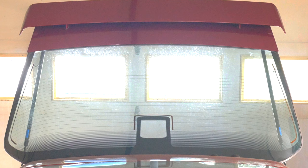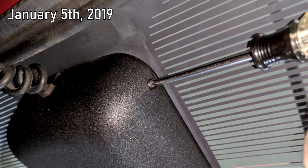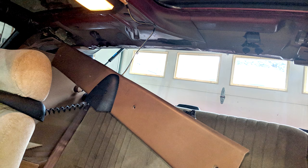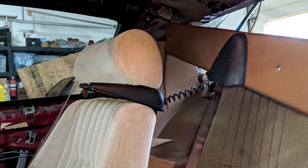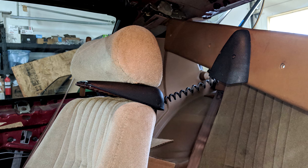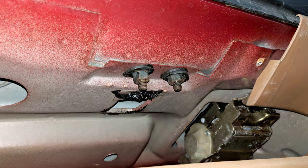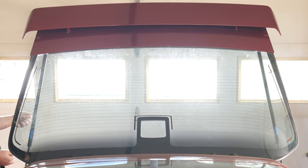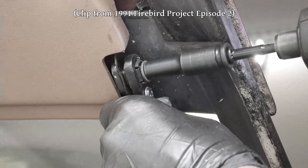To get started, the first thing we need to remove is the high-mount brake light. The housing is held to a mounting pad on the hatch with just two small screws. With the hardware out of the way, we can slide the housing off the mounting pad that's glued to the glass. Then we can remove the four screws holding that rear trim piece to the roof and pull it out of the way. Instead of properly disconnecting any wires, I just wedged the brake light housing in the passenger side headrest, which actually did a decent job holding that trim piece out of the way. Now we have a straight shot at the hardware securing the hatch hinges to the body. Before removing those, we want to make sure the hatch is ready to come off — we'll have a friend support the hatch so we can remove the defroster wires and disconnect the hatch struts.